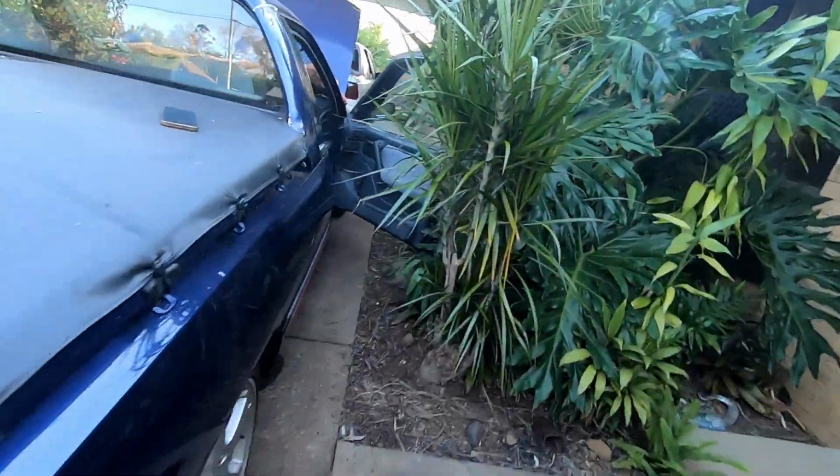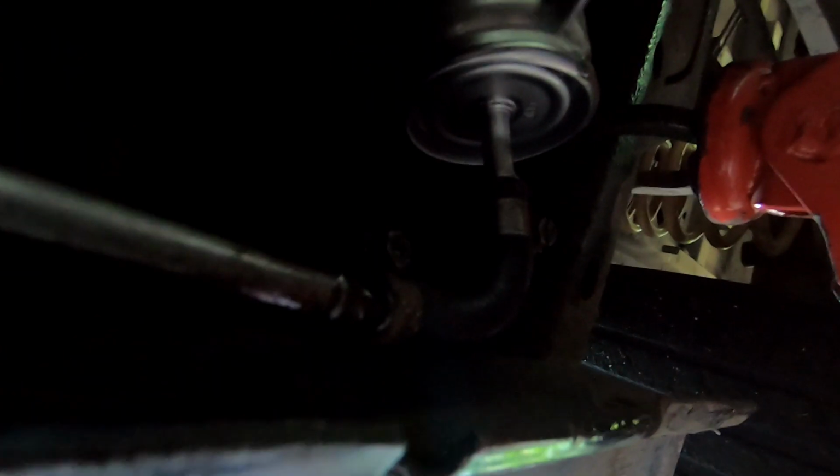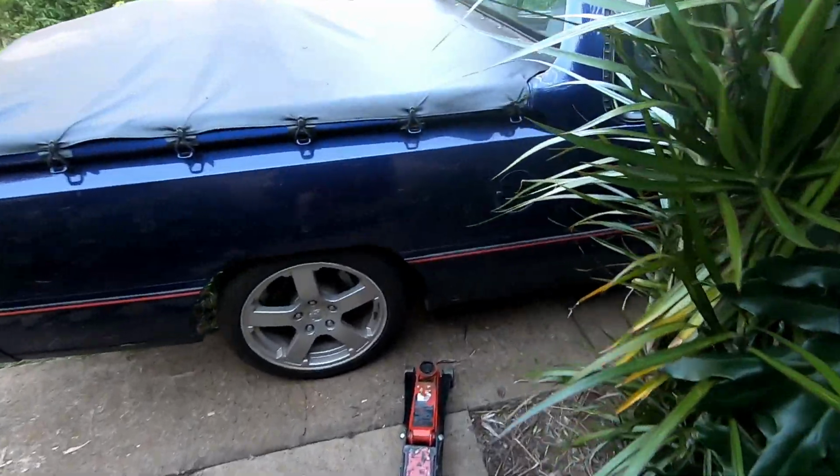So obviously didn't do it up tight enough, and there is a bit of a leak. I wanted to take a look under. I've got the degreaser in my eye. But I'll give that a bit of a dry first before I do that again, stupidly. It doesn't look like it's the fuel filter. It looks like it's this right here, because the fuel filter is actually dry. And that's still splashing me. So that was just a leak. There's just a leak on this joint just here.